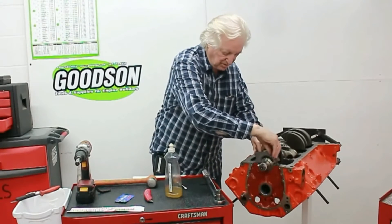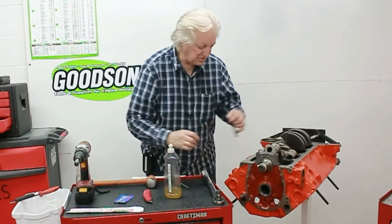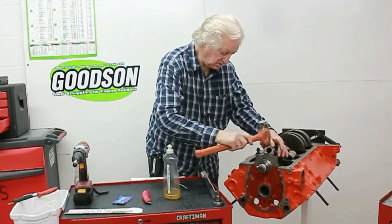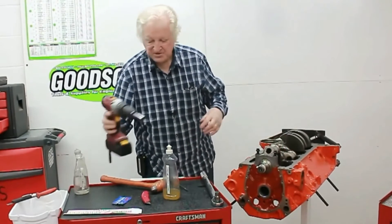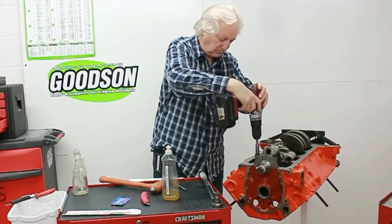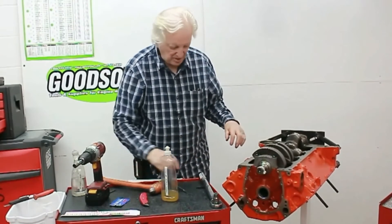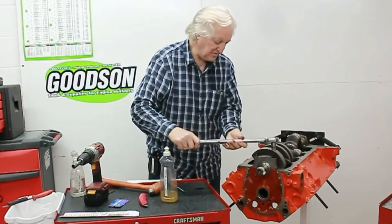Let me say what it's made of. It's a mix of 30% oil, 65% WD-40, and 5% lacquer thinner. This gives us a lubricant which is very good to find out if everything runs as free as it should. So I'm going to put some of this onto the bearing and spin it. Let's put some there and here like so — it's pretty runny stuff. Now we'll put the cap on, make sure it's the right way, and tap the cap in place. Spin the bolts down and torque them up this time to 75 foot-pounds — go about halfway on each one first, then all the way.